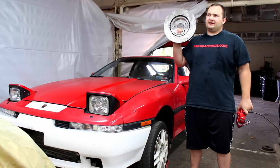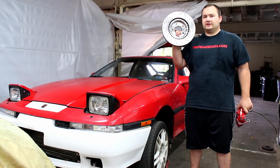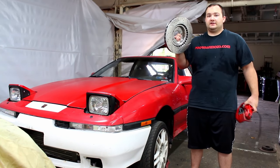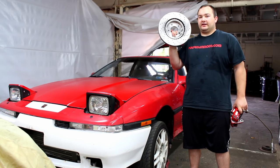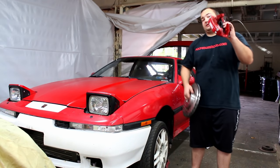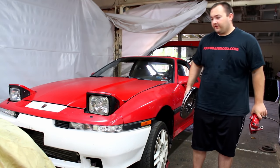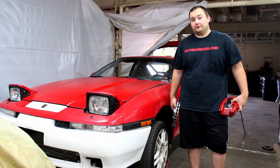I think it's either like the Touring or A-Spec edition or something — they're 12.8 inches. It's not the standard 350Z, those are smaller. These are the bigger 350Z rotors, they're 12.8 inches. So we're going to be putting 12.8 inch rotors and four-piston Brembos on the Supra, and the factory brakes are single-piston 11.5 inch rotors.